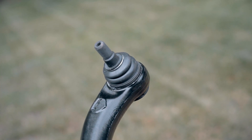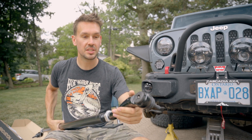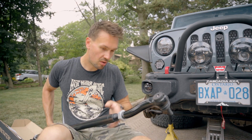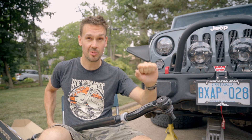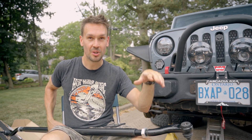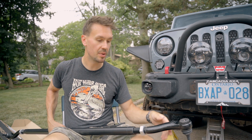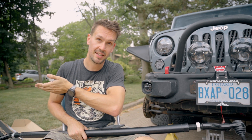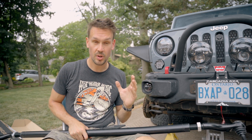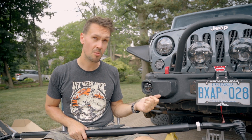The heft on the end — nice ball joints, chromoly, greasable, and we can always adjust the preload tension. It's also set up so that it minimizes tie rod roll. Normally when you grab that tie rod you can twist it, and sometimes when it's really loose it'll just clunk on its own on the road. This is limited to 14 degrees, so a lot less of that roll is going to happen. I'm also installing the Nexus steering stabilizer, but if you want to use your factory one, the kit also comes with the clamp for that.